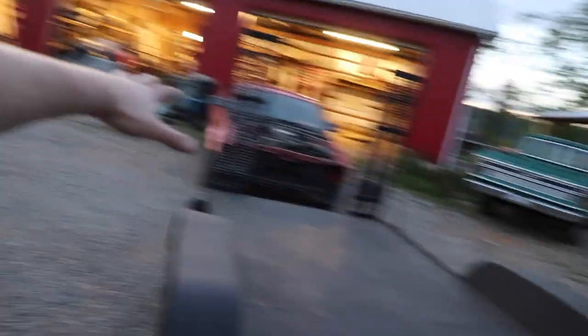We're going to take her over to the frame straightening machine — I'll show you guys that right now. My trailer has a winch on the front of it. What we're going to do is pull the Mustang up to the trailer with the bumper up against it for support, then run the winch wire from there and hook it right here. I have it on a little switch — we're just going to pull it a couple times. All the subframe has to do is come forward literally an inch or two.